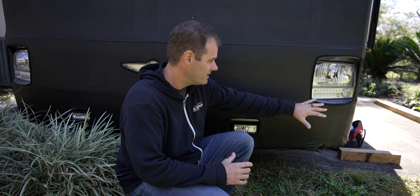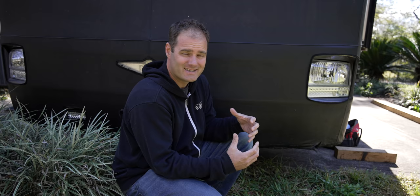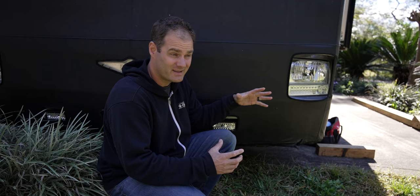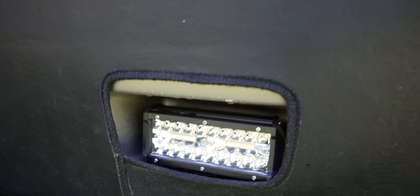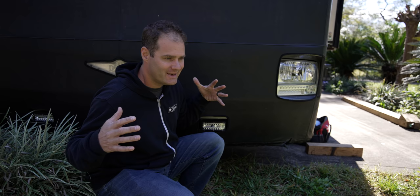I did some research on online forums and found the year and model of the headlight housing. It was like a Ford Expedition — I was able to get the exact same housing in a brand new light fixture and it was just plug and play. I just had to unscrew the old one, put the new one in, put the LED light in, match up all the wires, and it was good to go. I figured while I did that, I might as well put in some LED fog lights as well. Now when you turn on these lights — holy cow — it is very bright, focused, a ton brighter, and more energy efficient.